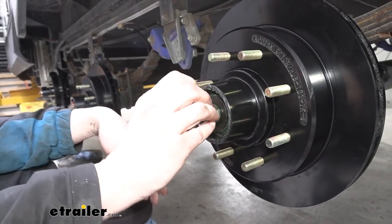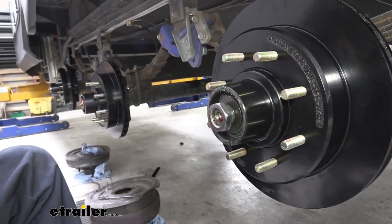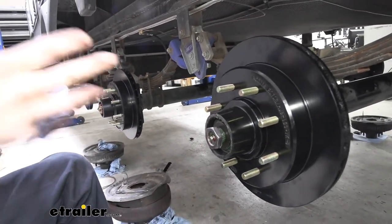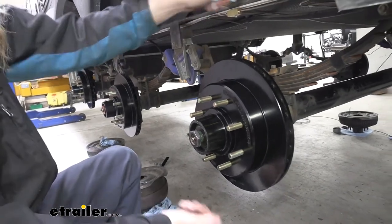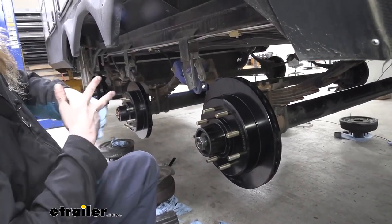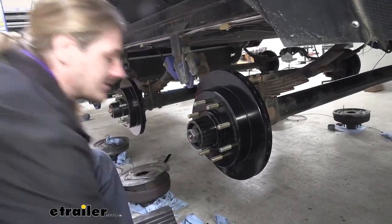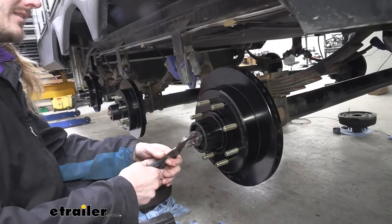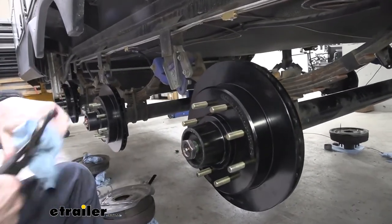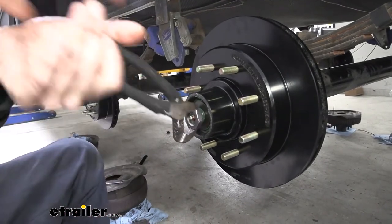Now this nut here, when we took it off, it was really loose. We kinda want it to be somewhat loose at the end. This is gonna adjust out the amount of play that we have in our bearings. Ideally, we want to eliminate it so there's no play, but it is better to have just a minuscule amount of play than having it too tight. So the way that I like to set it up, I'll grab my channel locks here and I'll start tightening the nut back down.